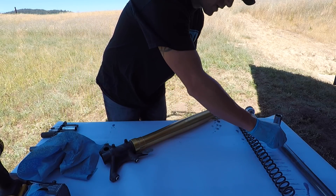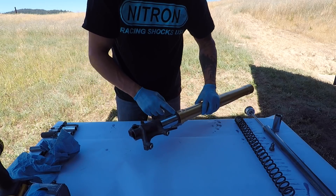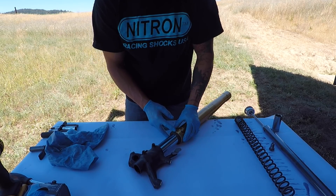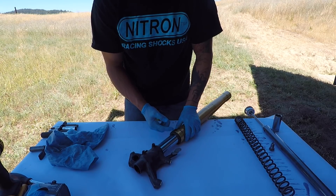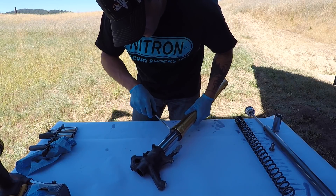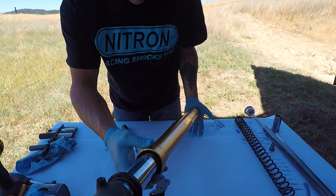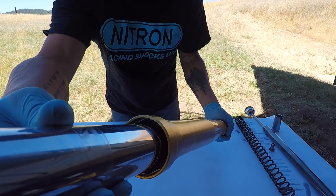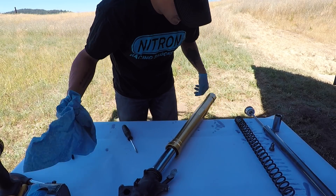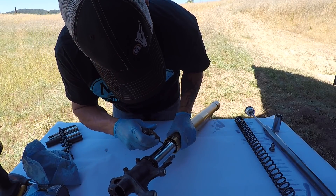Here's our bolt out of the bottom — hang on to that. From here we're just going to separate the fork so we can install our new fork seals. For the fork seals, we're going to take a small flat blade screwdriver and go around here very gently and move this dust cover. Inside of that there will be a clip that we'll remove to drive the old seals out. There's your dust seal — slide it down. And if you look, right down in there is a silver clip. That just pops right out and that is what holds the seal in. You can take a flat blade screwdriver — there's a little indentation on it — pry one side up and it comes right out.